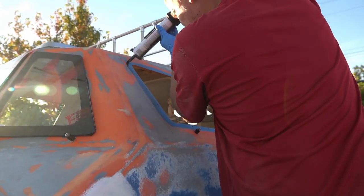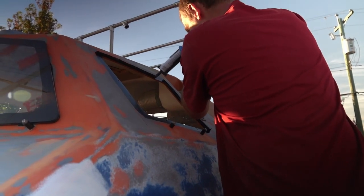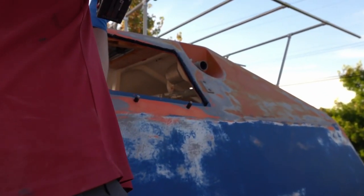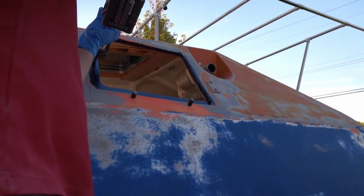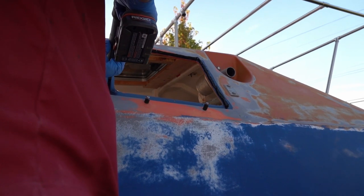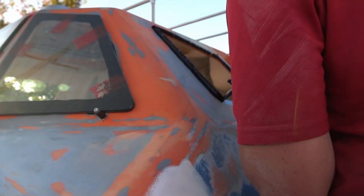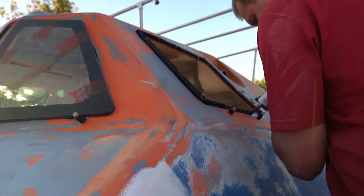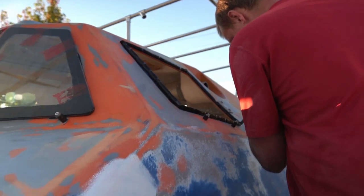While Torrin's busy gluing, what we found pretty quickly was that the bond somewhere between the primer and the boat and the glass failed, and so pretty soon Torrin's starting to cut it off. Much more difficult than we anticipated — this stuff does have a ridiculous hold strength when it works, and so even though it wasn't fully adhered anymore, it was still pretty well adhered. Obviously we don't want leaks or risk something coming off, so we made the decision to undo what we had done, go talk to the glass supplier. We got some different information from their installers than what the manufacturer suggests, and that set us up to redo the windows and do a better job on the big windows, which are the most exciting part and still coming up.